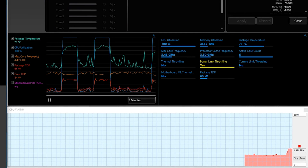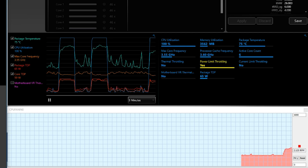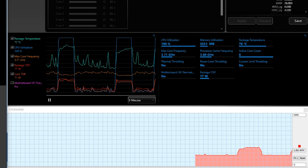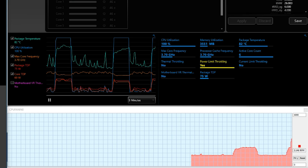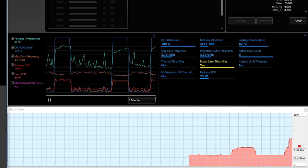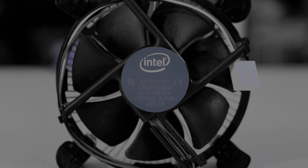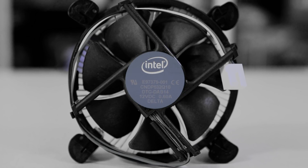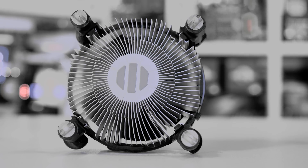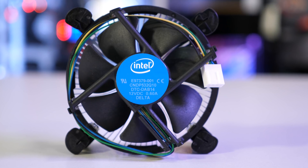With a package TDP of 65 watts, the fan on the Intel box cooler spun at 2,100 RPM — clearly audible but not outrageous. However, increasing the package TDP to just 75 watts saw the fan spin up to 3,100 RPM, and here it was a screeching banshee. So the entire Coffee Lake conspiracy can be blamed on the Intel box cooler, which is funny because in my last video I said their locked CPUs come with complete and utter garbage to cool them. There really isn't a conspiracy here and it's certainly no con job.